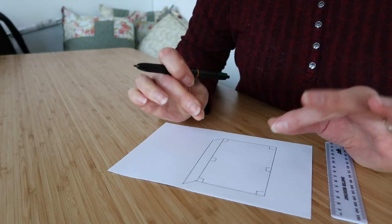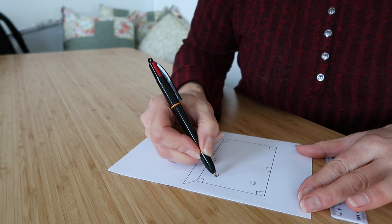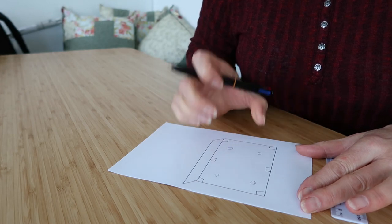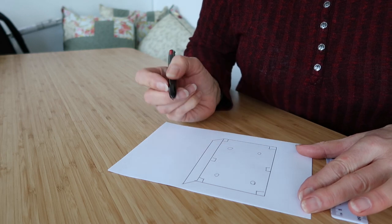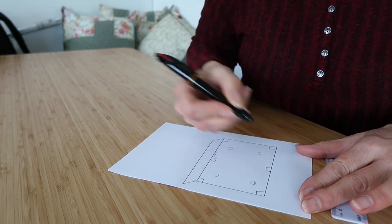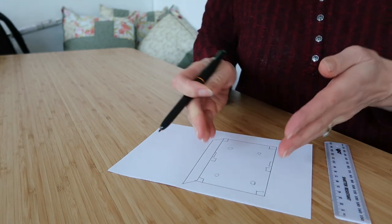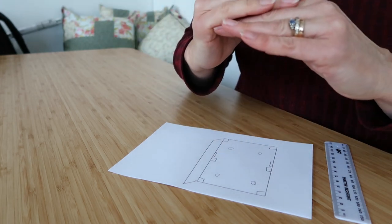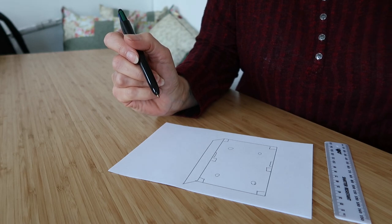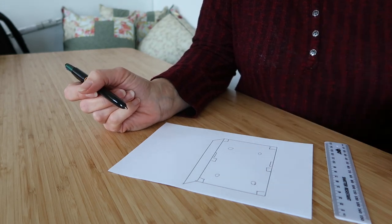Because the fridge has got four little feet, I want to gouge out four little places where the feet go. But I don't think that's going to keep it in place sufficiently when we're driving along. So what I've ordered is some webbing and some Velcro. I'll cut out a small gap on either side. Then the webbing will go underneath this top shelf, up both of the sides, and then over the top of the fridge where the Velcro will hold it. The top of the fridge won't be seen because that'll be underneath the countertop. So that's what I've got to make today.